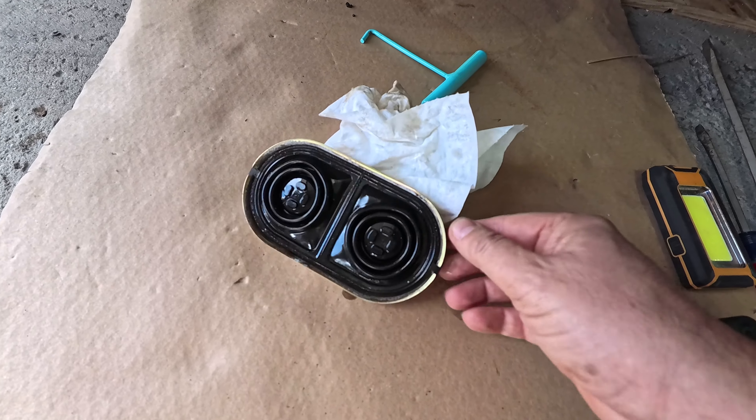This tells me that the back brakes are using this front cylinder, and the front brakes are using this back cylinder. I'm going to go ahead and fill it up again. Now I'm going to do the one-man method — it should be easy. This next one is very, very dirty. I emptied the bottle and put a little bit of clean fluid in. I'm starting to get clear fluid through. I am done with the back brakes.